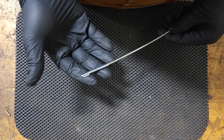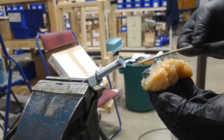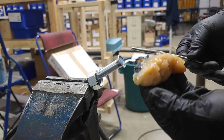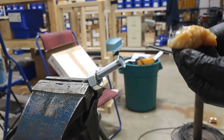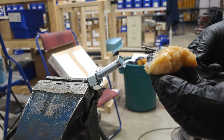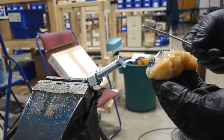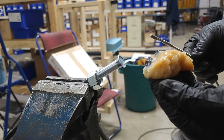Now this cable is ready for grease. As we get about halfway down, because of all the grease you're going to feel some genuine resistance trying to get this fed into the core. There's nothing wrong — it's just everything's gripping and lubricated, so it's a little stiff at first. That's why on these long cables we run them on a little machine first to make sure everything's all greased up.